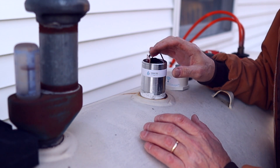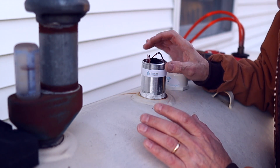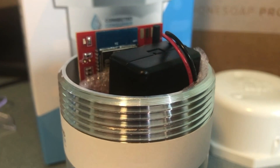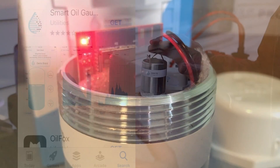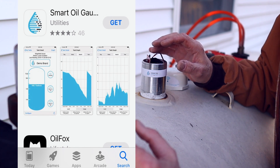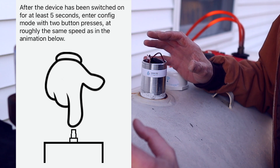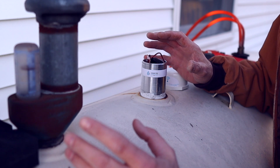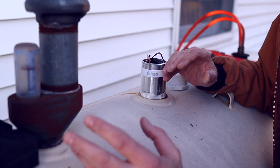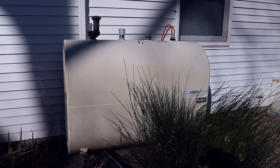The process for setting up this unit is pretty easy. There's an on/off switch on the battery pack itself. You turn that on, and then according to the instructions, there's a button on top that you click two times, and it sets it up into setup mode. There'll be a little flashing light, and then you follow the instructions on your phone after you install the app. My phone's an iPhone, so the app came from the App Store. They do make the app for Google devices as well. Now there is an alternative way to set up the unit, and I had to use that — I think it's because my router might be 5 GHz versus 2.4 GHz. But I couldn't get it to connect through the standard app, so I had to use the alternative method, which is a little bit more involved but still very easily explained in the instructions.